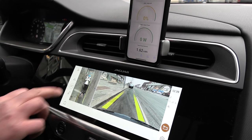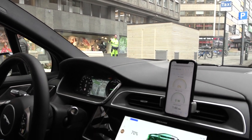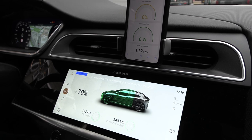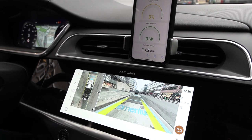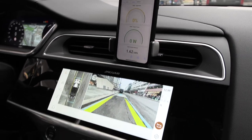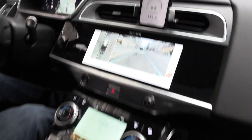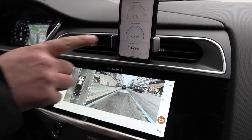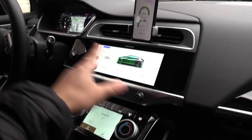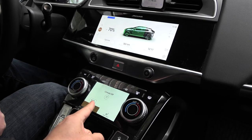We're at 70% — you can see it here. Now we're ready. We tell Olaf to start recording. So now this is counting the kilowatt hours — Olaf started the recording, it's supposed to be at zero now. One very important thing: we have to stop the heater. So now we put the climate off. We can count how many seconds it takes to start — about three seconds. Now we're charging.